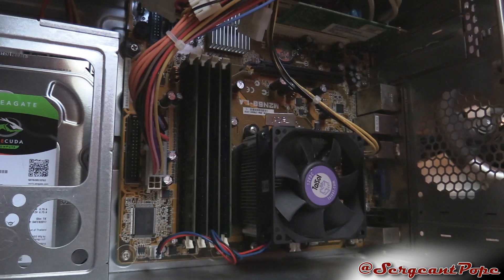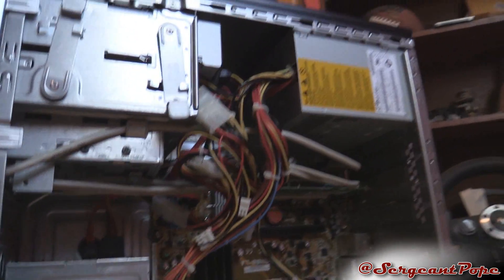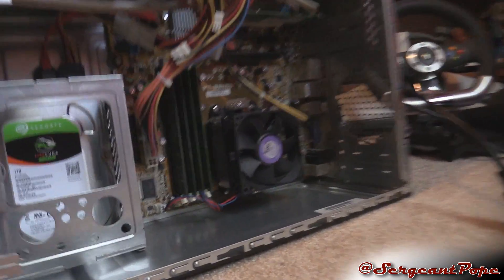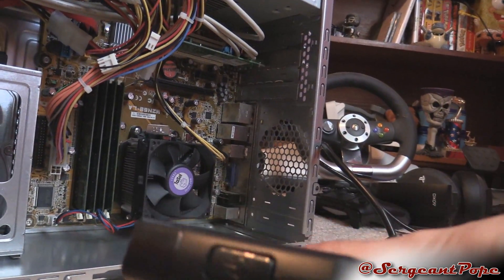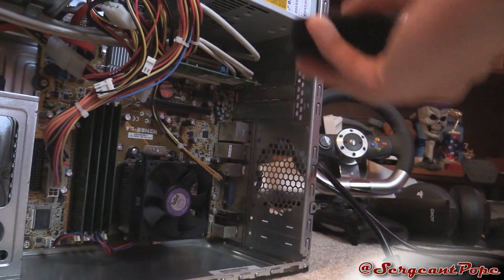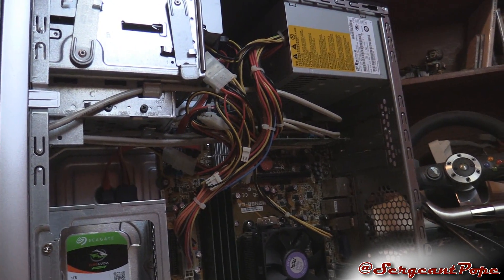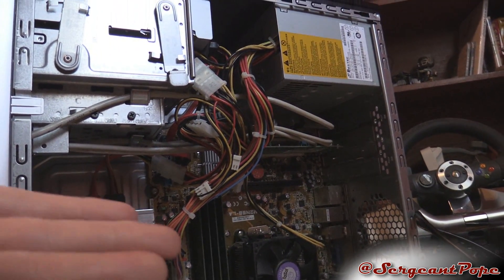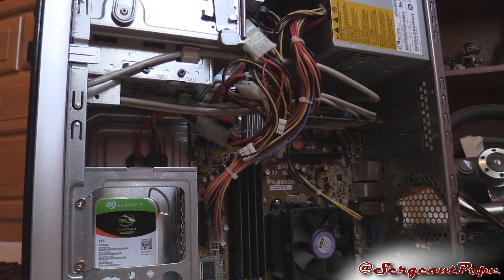At that point it's time to move on to other ideas. I was thinking the power supply, because the computer is totally shutting off. You can test that in a couple of ways. Here's a power supply tester from Thermaltake - you plug in the 24-pin connector and the CPU connector, click the power button, and it shows you voltage readouts and tells you if the power supply is going bad or totally fine. In this case it was totally fine. I still went ahead and put a new power supply in, but it still had the same issue - so it's definitely not the power supply.